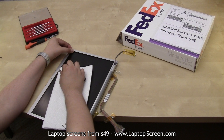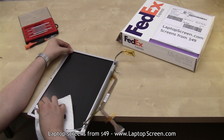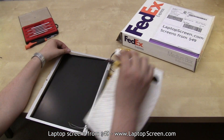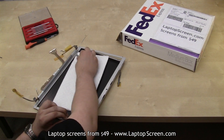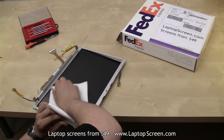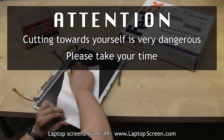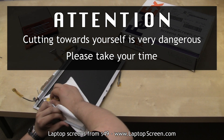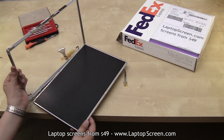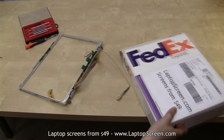Place the paper towel on the screen against the top edge and, exercising extreme caution, cut through the glue, sliding the paper towel together with the knife. Flip the screen around and repeat the procedure for the bottom edge. Make separation easier by keeping the bezel at an angle above the top edge. Cutting towards yourself is very dangerous — please take your time. Once you feel the glue has separated enough, start lifting the bezel upward from the top. Separate and discard the old panel.